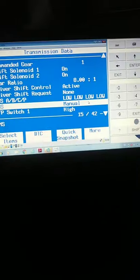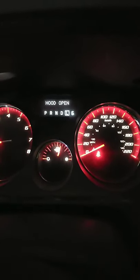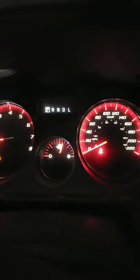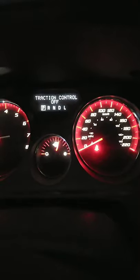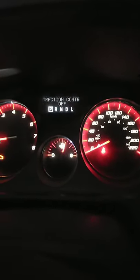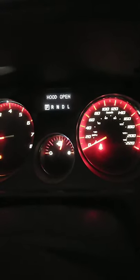Manual, manual one — as you can see: manual one, one, two, three, four, five, six. The customer also complained that sometimes the car will not start. Because of this internal mode switch — if the computer senses that the car is in reverse or drive, it will not be permitted to start. The car should be in park or neutral.